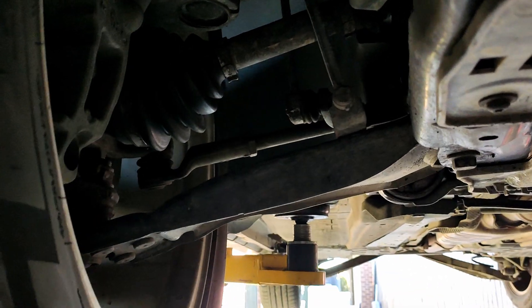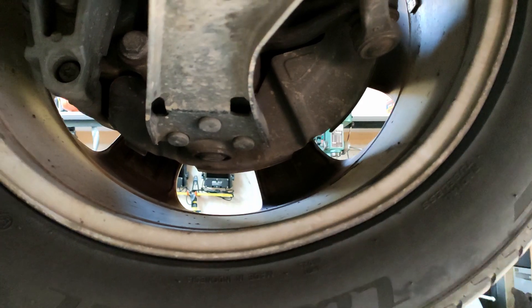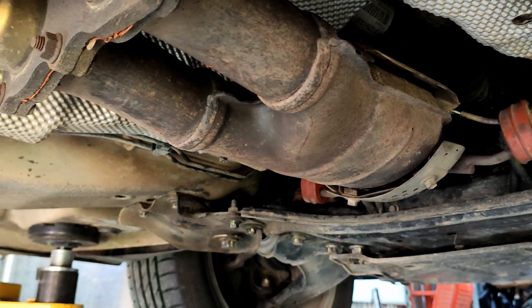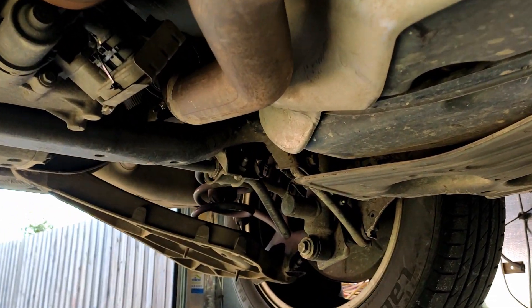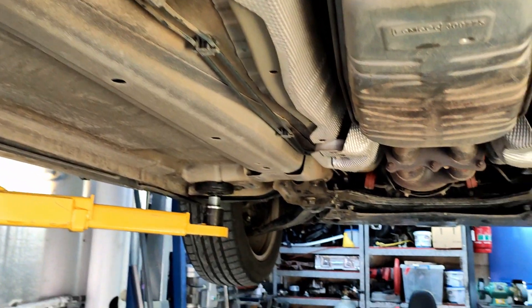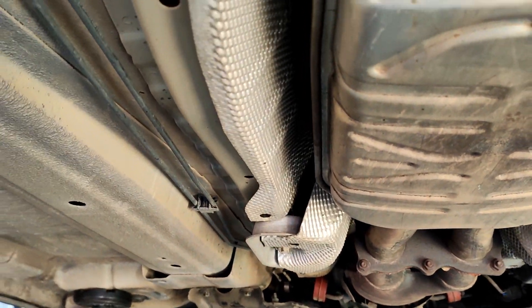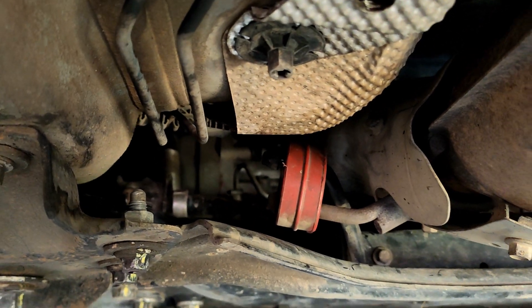You can see I've got things like the active headlight sensors — I already had these for the adaptive headlights, but now there's four of them because the 4C uses one on every wheel. The brakes were the same — I just picked the better of the two as far as life goes, which I think was the V70 ones since they'd been better maintained than mine. The V70 T6 exhaust fits straight up as expected — the floor is exactly the same. Volvo like to have no joins in this exhaust from factory, so I added a V-band join here so if I decide to make changes in the future, I don't have to cut it out or drop the rear frame to get it out. I've added in all of the heat shielding again from the T6, because I had it from the parts car and it's there for a reason. The D5 I had was a twin turbo one so the heat shielding was higher, but it was thinner and there was less of it.